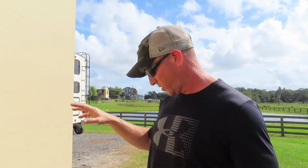So the bottom line is, make sure you're charging the batteries correctly. Make sure you're maintaining your batteries correctly. If they're flooded, make sure you're checking the water. You'll really save yourself a lot of headache if you just go ahead, spend the money up front, and buy some AGMs, whether that's 12 volt or 6 volt. Even if you just have a single battery and no interest in adding additional batteries, you can still upgrade to an AGM. It's an investment up front, but not having to worry about your battery for 4 years, that kind of peace of mind is well worth whatever that battery costs up front.